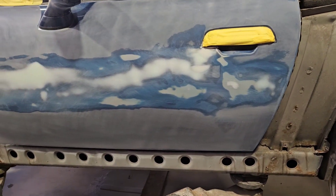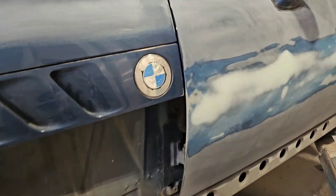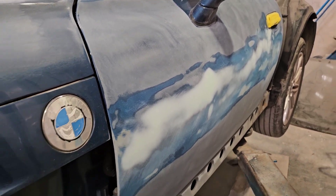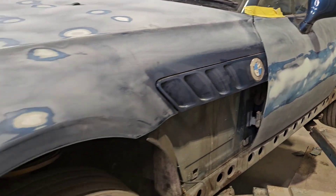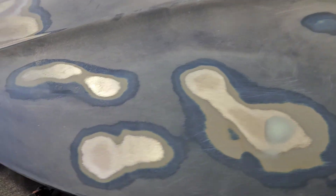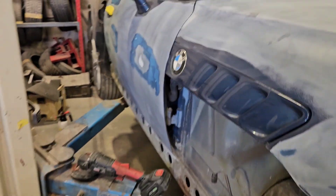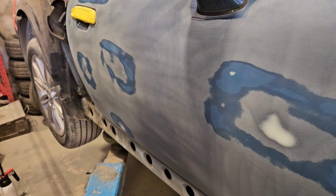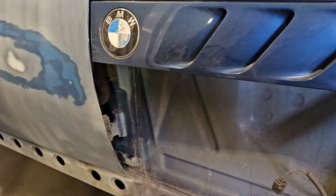Okay, so that's it virtually finished. We have got the door all prepped - just a few dents that turned into a bit more filler. That was all just car park dents all the way along, same level. I'm always particular where I'm parking in a car park - obviously other people aren't. Bonnet is all down to the metal where it needs to be, couple of wee dents with filler in them. So that's ready now for primer, and this panel here as well - not so bad, couple of wee dents. Still to take the mirrors off but that's the whole thing ready for primer.